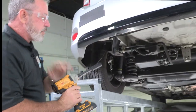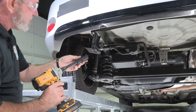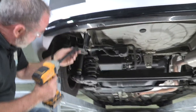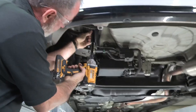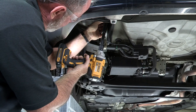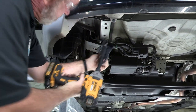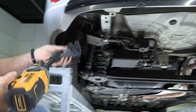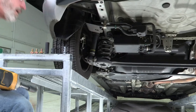Let's get right to it. I'm going to go ahead and use a drill motor with a 6-inch extension and 17-millimeter socket. That'll drop down our tow loop here — it's just two bolts. We'll go ahead and return this to the vehicle's owner in case they ever take the hitch off and want to put it back up.